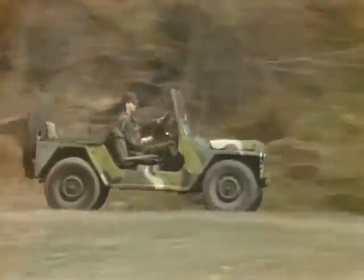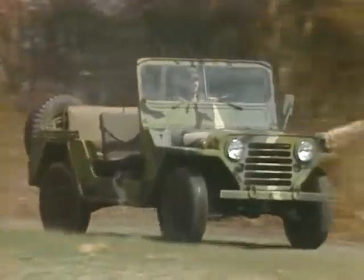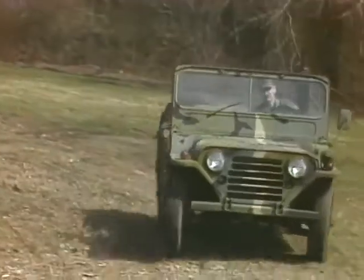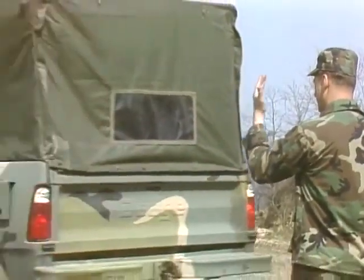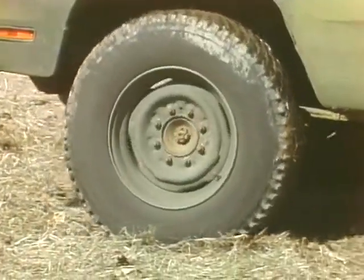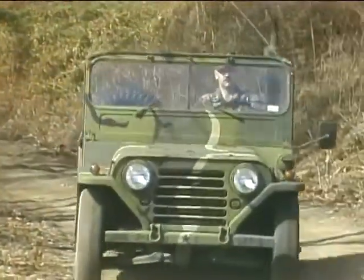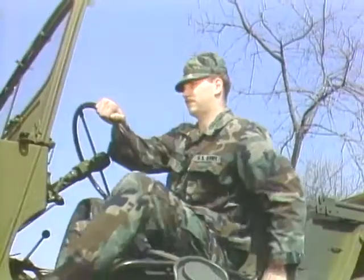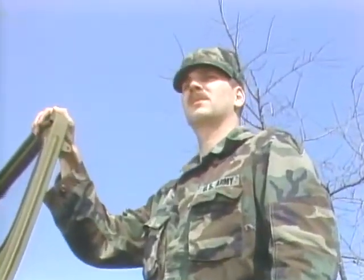Among those, the ones you're likely to see most often are the drum brake systems used on M151s, the quarter-ton 4x4 utility vehicle the Army has so many of. But there's also another type you need to know about. The M880 one-and-a-quarter-ton cargo truck uses drum brakes in the rear, but up front it has a disc brake system. As a wheel vehicle mechanic, you've got a lot of personal interest in making sure those brakes are working, because the vehicle whose brakes you maintain or repair, you've got to road test.